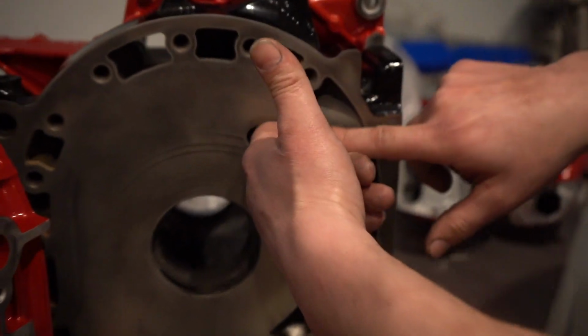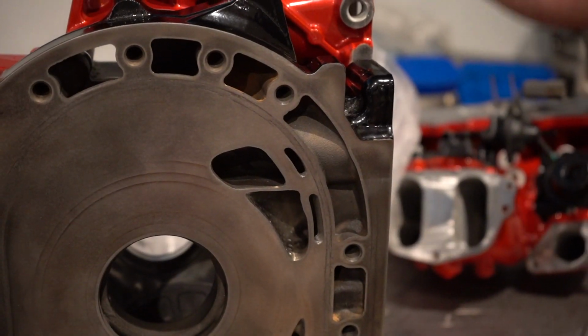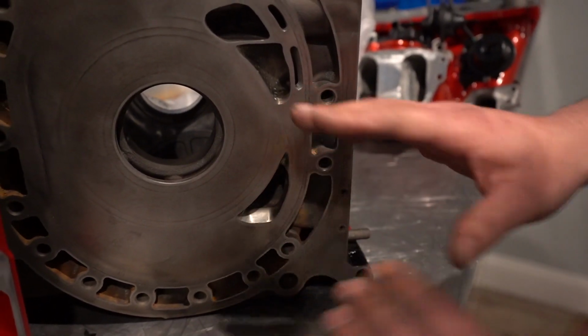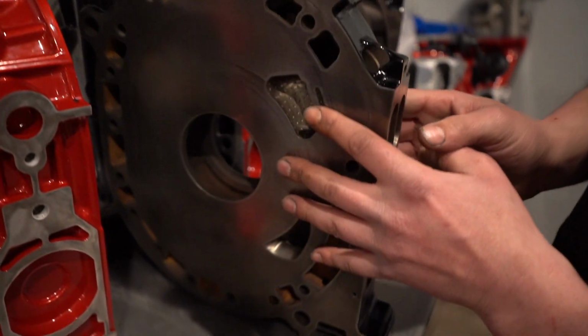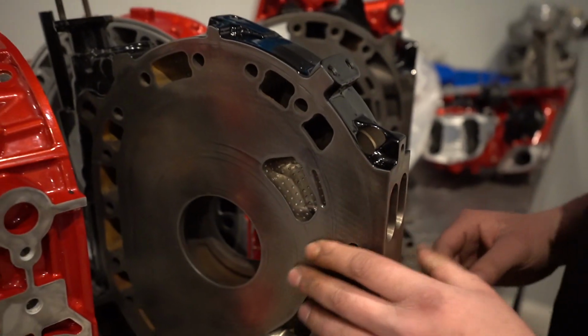Now we also have our 6-port bridge here as well. Obviously, if we open our 6th port, it's above 6,000, and it doesn't make any more power, then there's no point in doing this. Now I did do the largest exhaust port I could possibly do on a Renesis here, so we're going to see how that works. Now this is a full bridge, so the center plate is bridged as well, with a golf ball and my large street port on that as well. So we'll see the increases in the power bands as we step up.